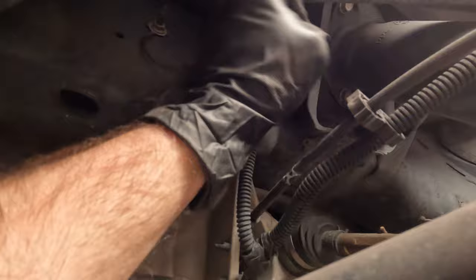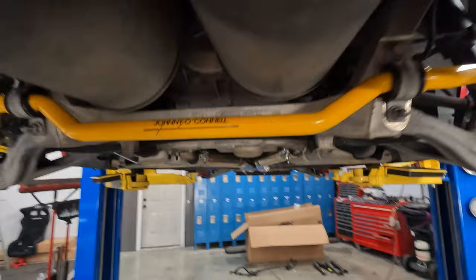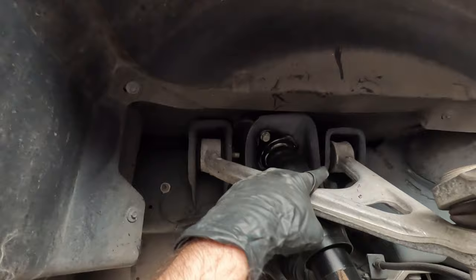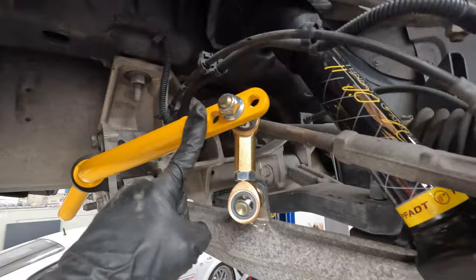Same process for the rear. The top of the rear shock — rather than having one bolt, you've got a top plate with two bolts, one on each side, and then a big bolt through the bottom. The sway bar is a lot easier to get to in the rear. I ended up doing the same thing as the front — taking the upper control arm off — and that allowed me to get the shock out the top. Same thing with a stand underneath to hold it and take the spring pressure out. Got it on the middle adjustment point right now; it has a couple other settings if I wanted to set it up differently.